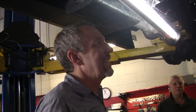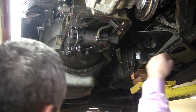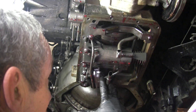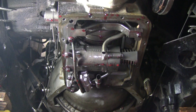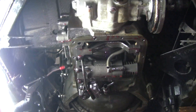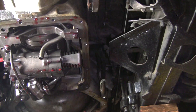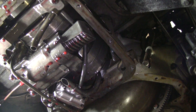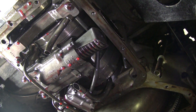What were you pointing to up here that we were all afraid to come look at because we didn't want to get sprayed? There is a band right here. You've got a piston right here, and you've got a stop on the top which is where you adjust it. The band goes around the outside of the drum, and when you air pressurize it, it squeezes on the outside — so that applies. It's very slight, because when it's adjusted properly it shouldn't have too much clearance.